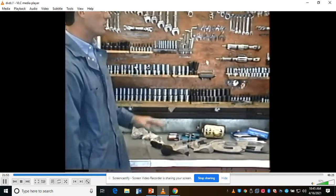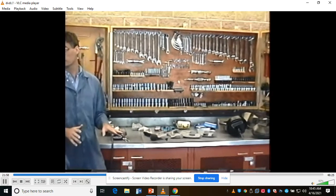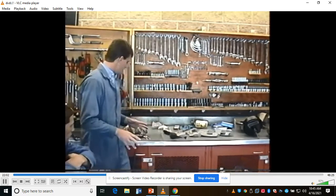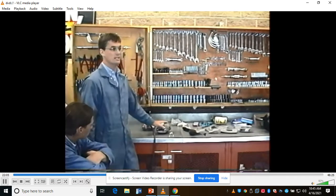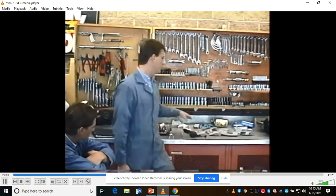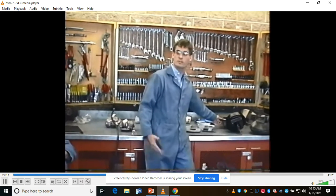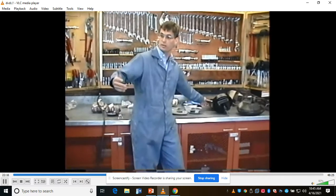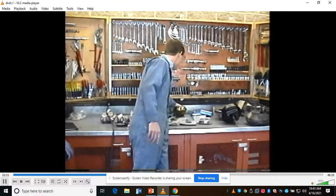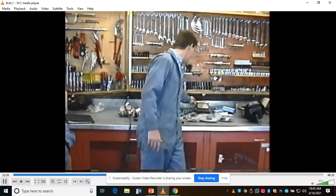Right now the going price in the junkyard is $250, and that's just off an old car. Okay, that's nothing rebuilt, it's nothing new. The problem with that is the calipers, after that kind of mileage, usually at least need to be rebuilt, because the seals inside them wear out. The rotors, after a lot of miles, of course, they get too thin, beyond legal limits, and you can't turn them any further. The master cylinders, here's the new master cylinder here, the master cylinder seal wears out, and that'll eventually probably have to be rebuilt.